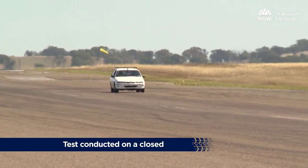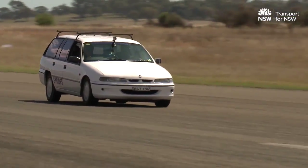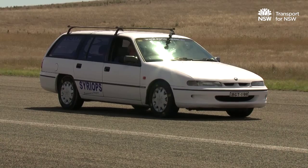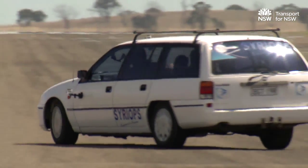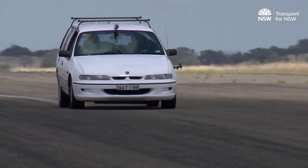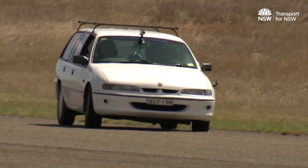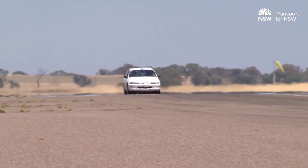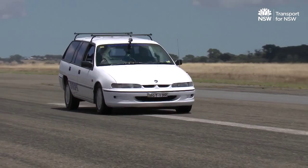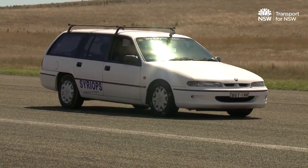This test checks brake performance when they are hot and are being brought back to a normal temperature range, and is done immediately after Test L. The vehicle is stopped four times from 50 kilometres per hour to a complete stop with the engine connected. Immediately after each stop, the car should be accelerated at its maximum rate up to 50 kilometres per hour and that speed maintained for at least 1.5 kilometres before making the next stop. If the test facility is not long enough, a shorter distance can be used, though care is required as the brakes may not get enough time to cool down between runs and could overheat.